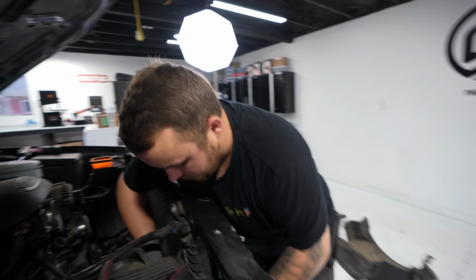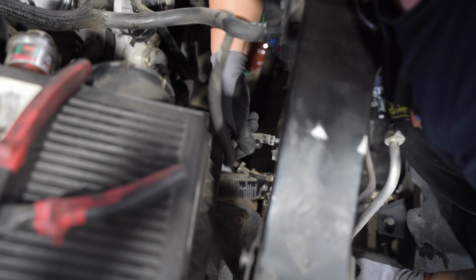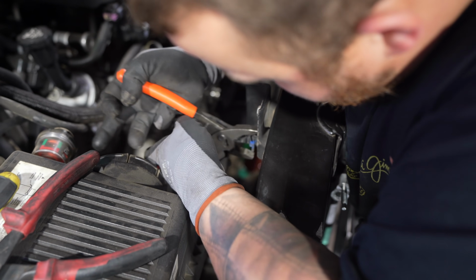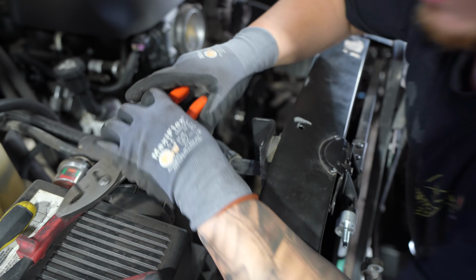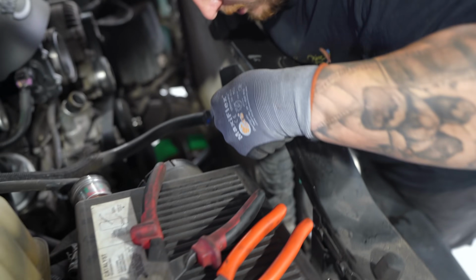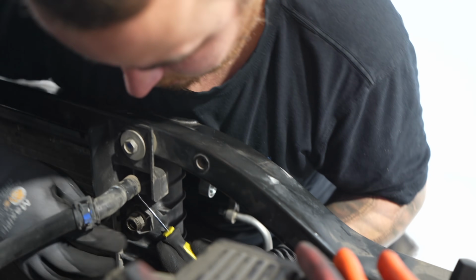Obviously we're taking them out, so we have another hose right here which goes up into our throttle body. Pull that off. So just gonna let that hang out over there. Have our other one right here. Sometimes if the hoses do get stuck on there, use a pick, just be careful that you don't puncture a hole in it. But you can get up in backside of the hose and kind of work it around, and that'll free it up.